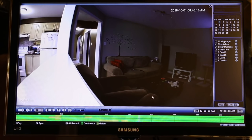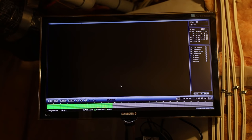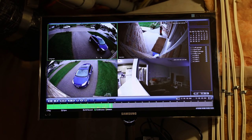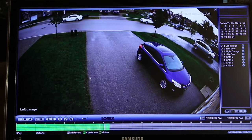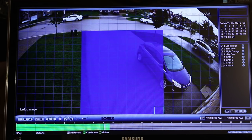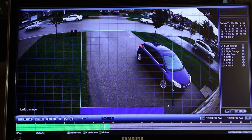If it's green, it's just continuous recording and nothing was detected. Green means nothing is happening in the actual screen, so you can tell based on the yellow when there was action on one of the cameras. There's a feature I really like in the playback called smart search. Essentially, you click this icon, highlight the area you want to see motion in, re-click, and the playback will go through all the footage and show you anything that moved inside that box. That's really handy if you want to see a certain area without having to scroll through hours of footage.